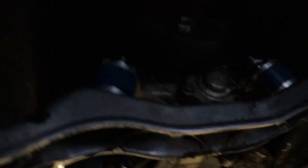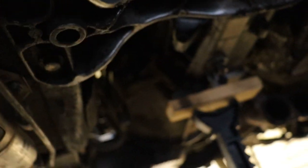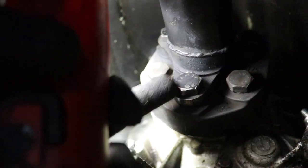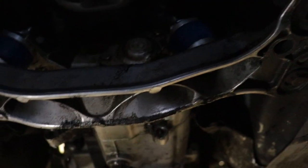Next plan: loosen the transmission mounts and then loosen the brackets that hold the transmission mount so the transmission is fully loose — that's why I've got the jack stand up there. Then we can move on to the driveshaft bolts. You have the little donut and then three bolts that are actually attached to it, so you only need to loosen three. It's 18 millimeter and 13 millimeter. I'll start with these, then move on to those, and then the driveshaft itself.